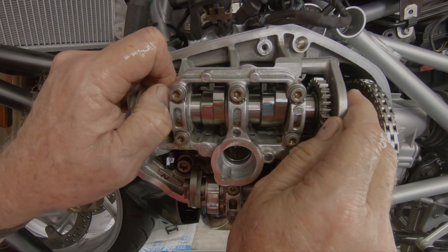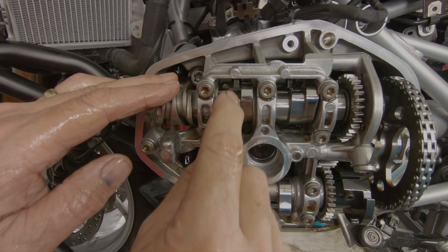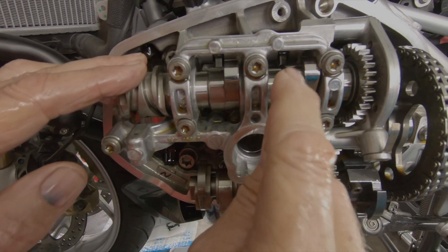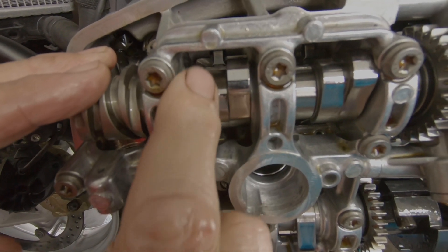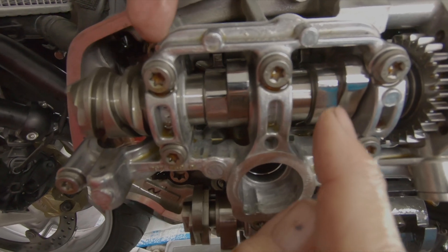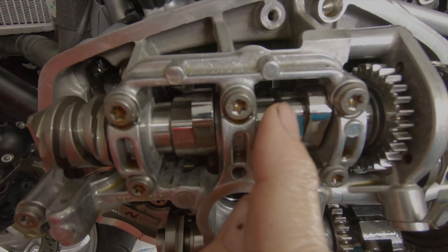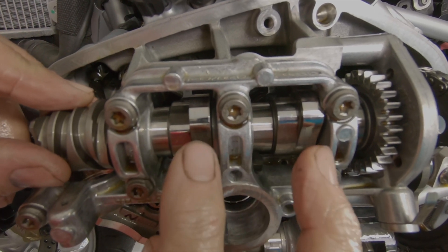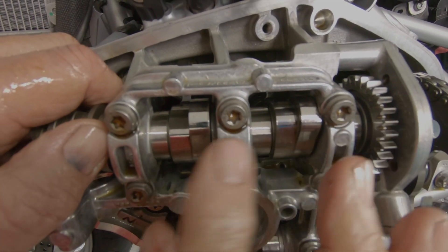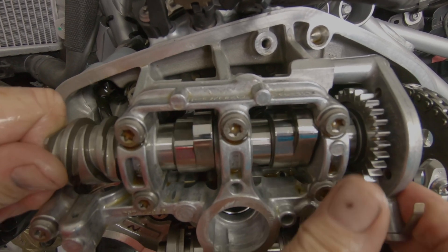The axial pin is what keeps it in low or high profile. One of the interesting things about the intake cam is that the low profile is different on the front valve than on the back valve — the front has a lower lift than the back, and they also open at different times. This provides a swirl effect of the intake charge coming into the cylinder, which helps evacuate old gases and bring in fresh charge. The high-profile lobes also have different lift, duration, and timing from each other, so they too provide a swirl effect.